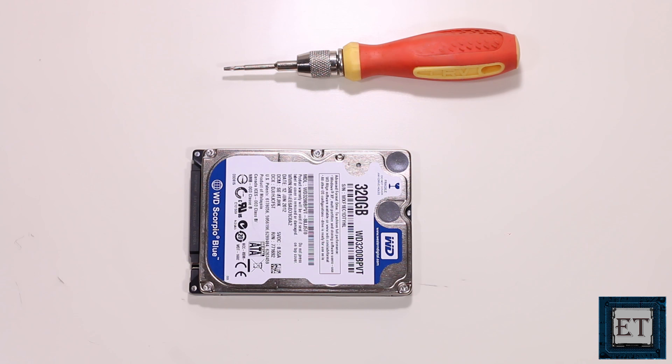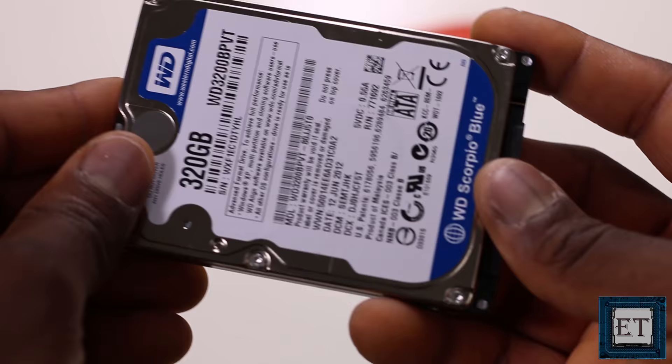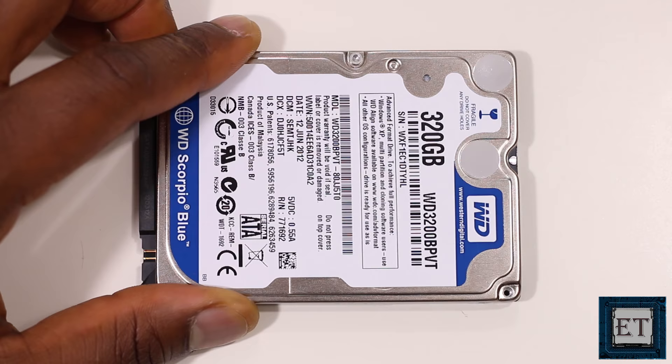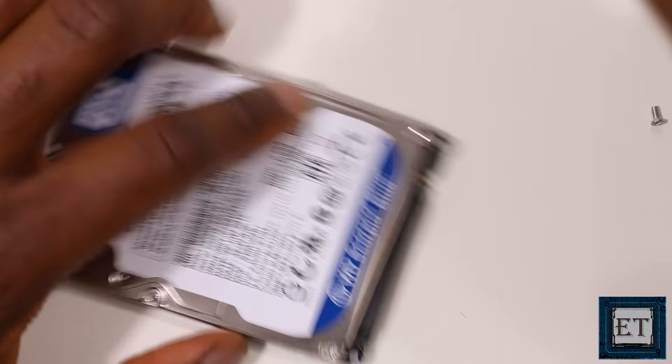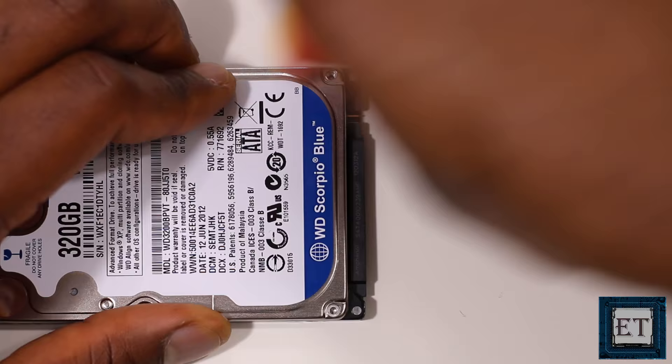So first, we're going to open up the disk, and for that we'll be using a T6 Torx screwdriver like this one. While unscrewing, you should be careful not to cause any damage to the cover or the platter, because the platter is located just beneath the cover. You might need to do a bit of research to locate all the screws on your cover, because some of the screws are usually hidden underneath the label. An easier way would be to remove the label and reveal all the screws, but this would leave you with a sticky, shabby-looking disk. If you don't mind the aesthetic damage, you could simply remove the label, or carefully trace the hidden screws from the top of the label and unscrew them.